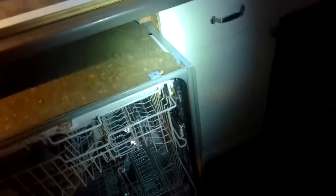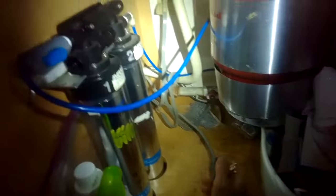Most times you don't have that trim piece. I'm just going to wiggle this out, keeping an eye to make sure I have enough drain line and fill line so I can get this out without having to disconnect anything. I do want to make sure I unplug it though, so I'm taking the power cord out. I also have the water turned off at the water valve underneath the sink.